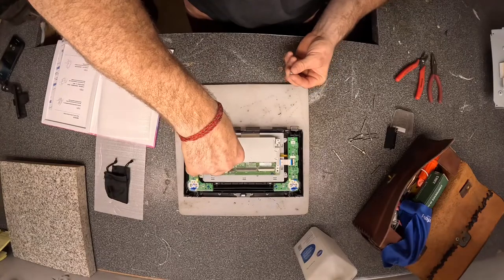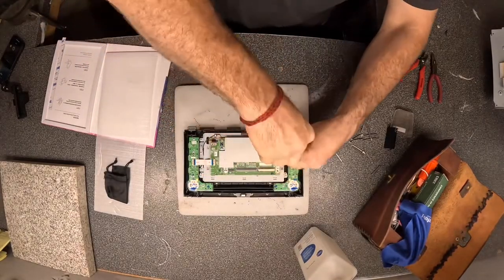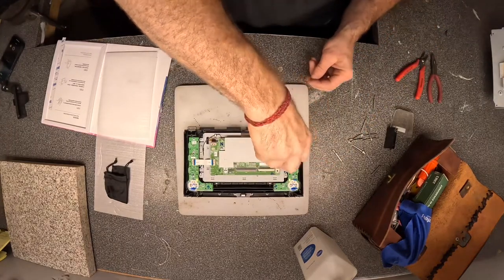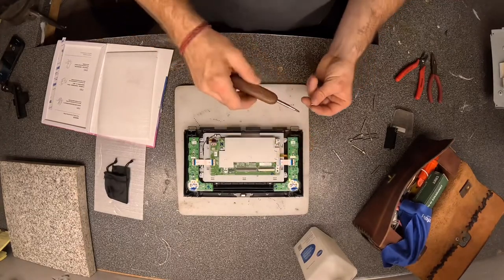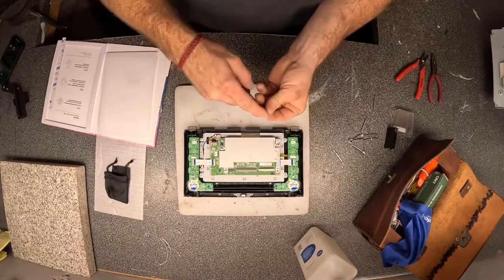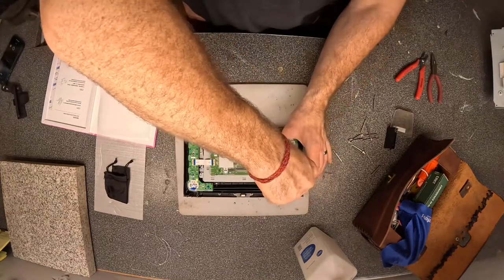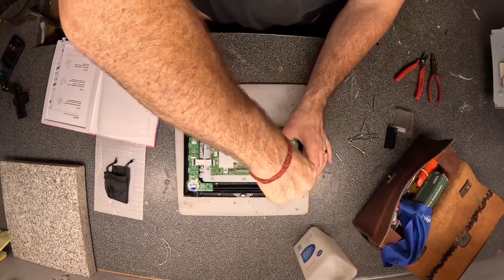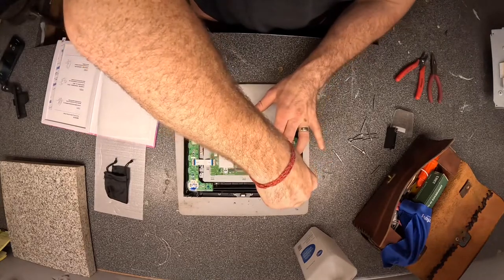And just hand tight. I learned working with a really very smart airplane mechanic a handful of years ago, 10, 15 years ago, maybe a little more. That one bolt that you're putting all your force into to get it tight, that one bolt's not holding that plane together. The 90 you put in at the proper torque hold it together.